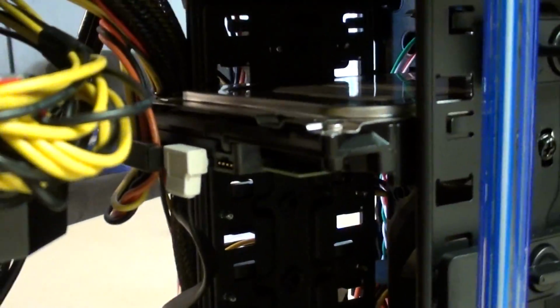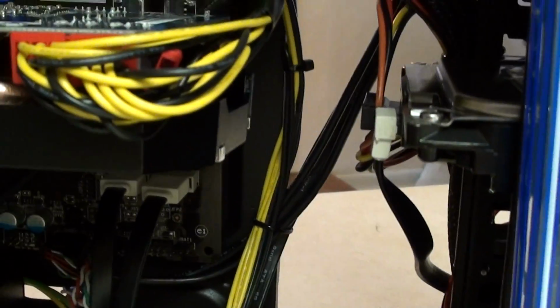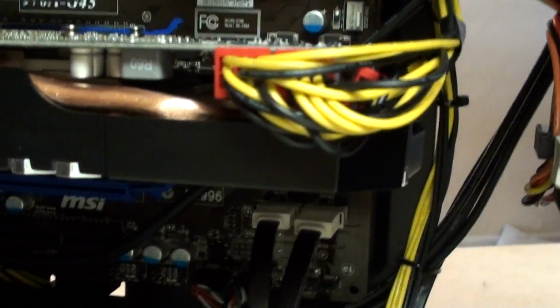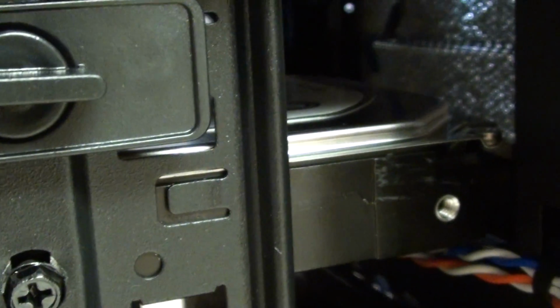room to play with. We mounted the hard drive here instead of where they wanted, which is a couple slots down. That's because once the other 6870 is going to be cross-fired, there's not going to be any room for the hard drive. As you can clearly tell, there's barely any room as it is right now between the hard drive and the vid card, and we have the hard drive going into one of the 3.5 frontal bays that we're not going to use for this build anyway, so I'm not too concerned.